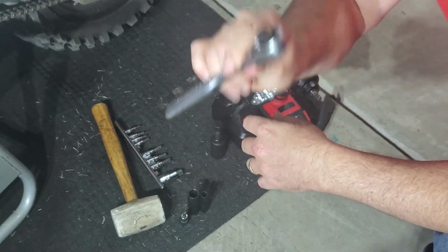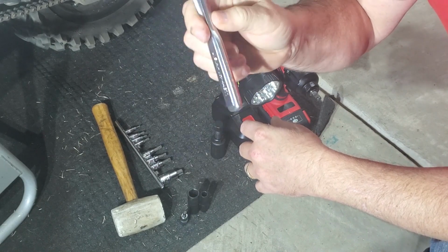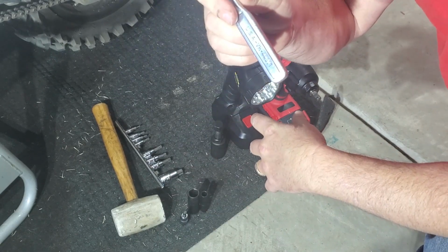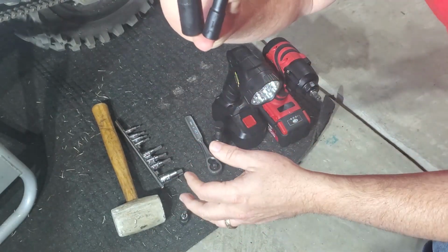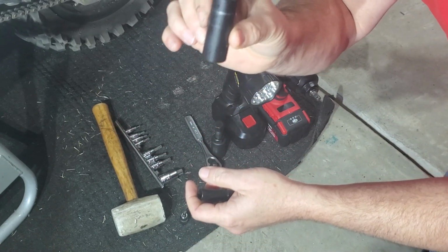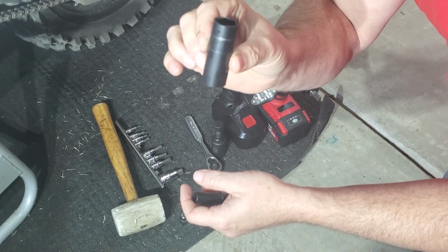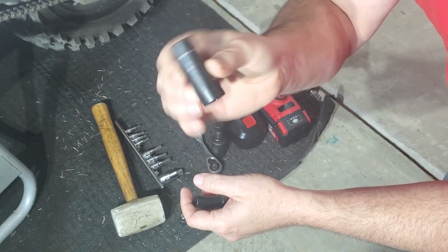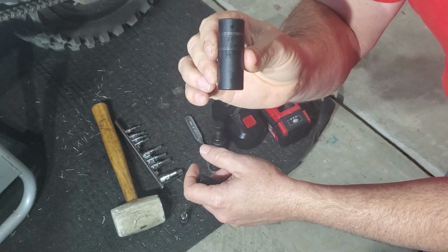You're going to need a socket wrench and some sockets. This is a 3/8 drive one that I'm using. I would say you need a 3/8 as opposed to a quarter for this job, but either way. These are my impact sockets that I have for this. Specifically, the 17 millimeter is the bolt that holds on the flywheel, and that one's torqued very, very hard. High torque value of 56 foot-pounds, so I would say that a regular socket's not what you can use. I mean, try it, but if you have impact sockets, 17 millimeter.